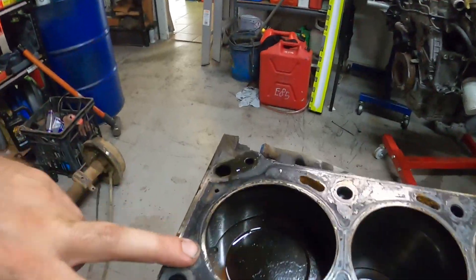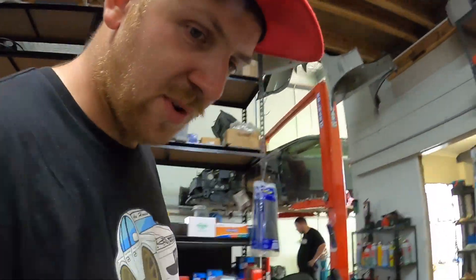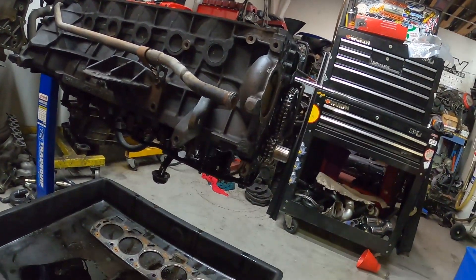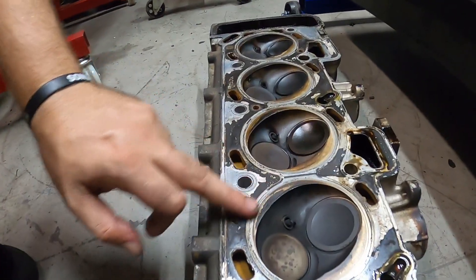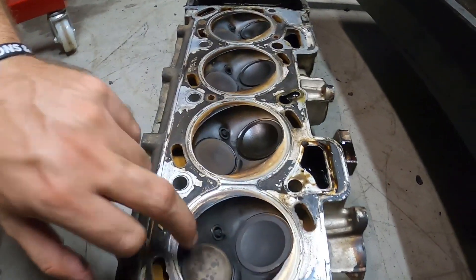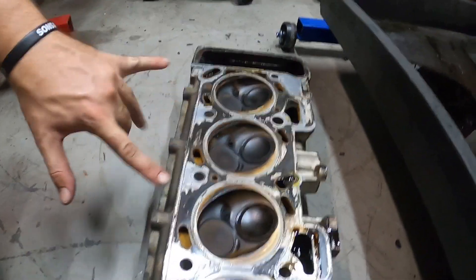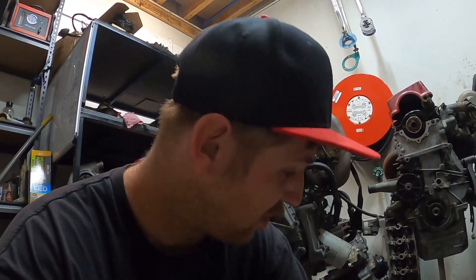These motors are damn — it's obviously going to need a rebuild. The head still looks pretty fine, honestly. This thing was over-boosting bad. And it's not even — this is like 380,000 kilometres when I started with it. That's still pretty alright. I'm guessing some cylinders are a bit dry, one's a bit more dry, that one's alright, that one's a bit oily. So something's going on there. We'll pull off the con-rod bearing and suss that out. The head actually looks pretty damn good.